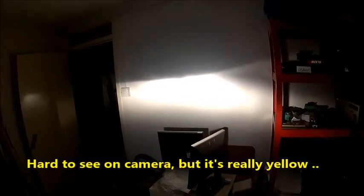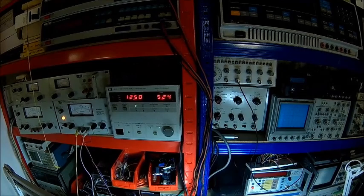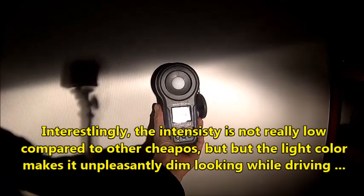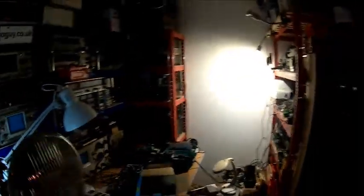Here we got that CEC. We can see the beam is very yellowish - strange one. It draws 4.5 amps on low beam and 5.3 amps on high beam, but it's still very yellowish, not white. So let's see what the light intensity is at low beam. It's exactly what I observed on the car. There's my meter - yeah, it's dim. It's 1200... 1550 with some goodwill. 1550 - that confirms my feeling I had with the car. It just looked like candles.